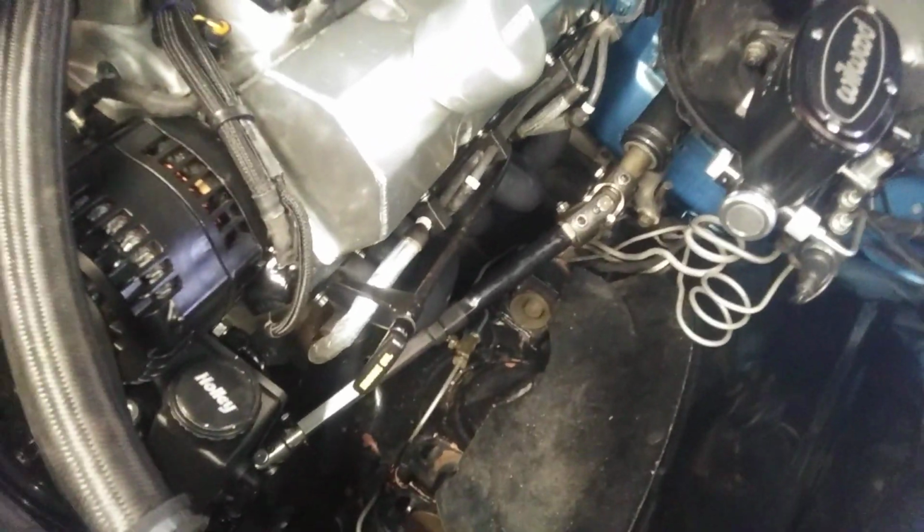So that's about it, I guess, for what's going on here. Holley mid-mount system, made a video about that. The Holley spring is really light in this throttle. Maybe I'm used to a heavier spring or something. So I added a spring. You can see it right here. Just put a mount for it there, and put it into a little mount here that's kind of made for it, I think. And heavied up the throttle spring, and plus I like having 2 throttle springs in case something happens to one of them.